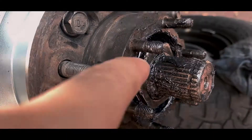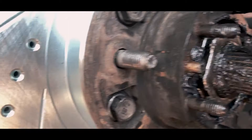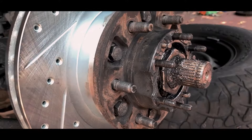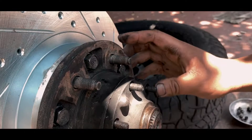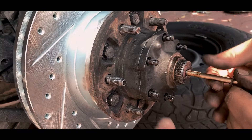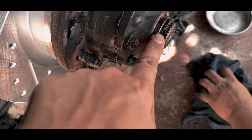Because this car has been previously punched in already, I'm going to punch it in the other direction to tighten it a little bit, but not too tight. Don't forget to punch the retainers back — backwards and forward — that way it'll hold both nuts. So now we're going to bend the retainers back. If you run across an emergency and you don't have a gasket, just use RTV for now until one day you can replace it or redo it again. You'll need a little bolt to pull that out so you can put the retainers back on. Star pattern on all of those — do the same process, chase it with a hammer and a flat head so you can put it back together.